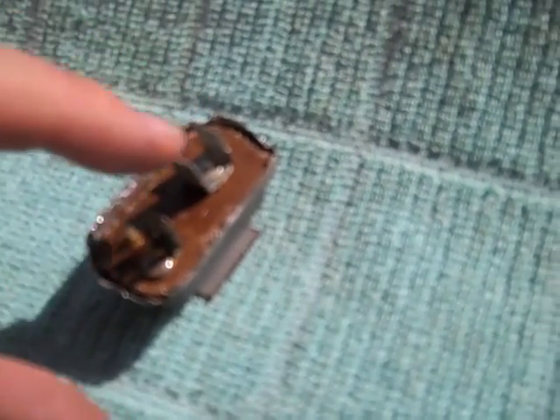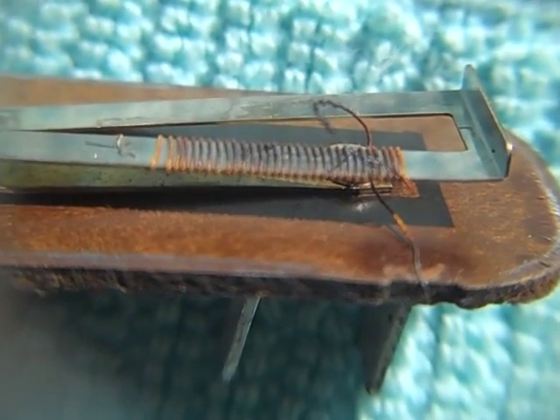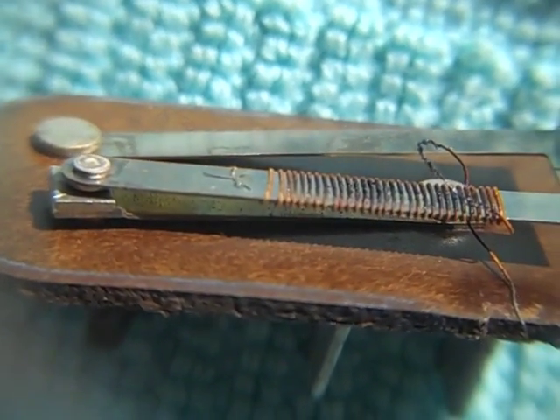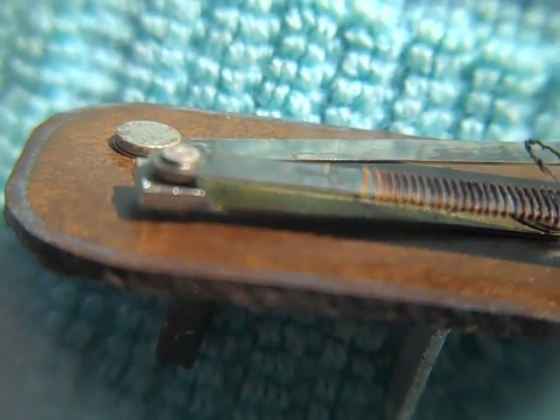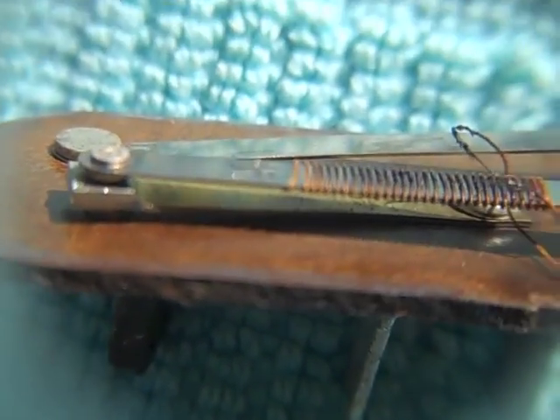The little connectors on the outside kind of vary a little bit. I pried mine open and found that it is important to have a good source of ground on your Mopar Chrysler voltage limiter. The source of ground helps that little heater — that little coil wrapped around there is a heater. It heats up the bi-metal strip and then opens up the contact points, bringing the average down to about 5 volts.